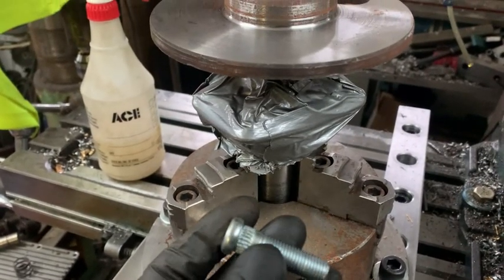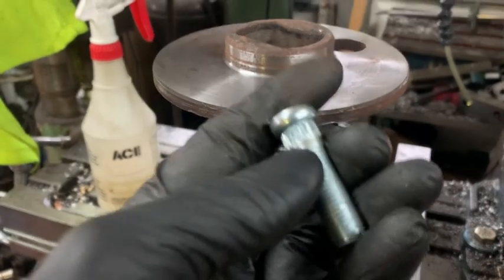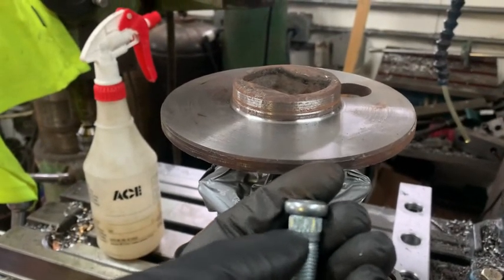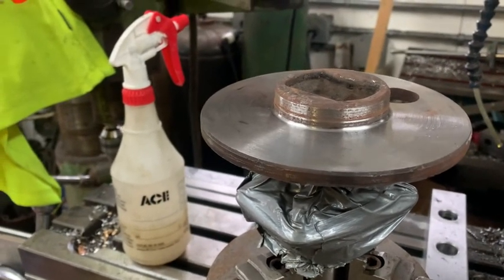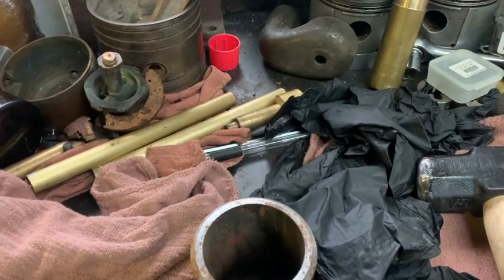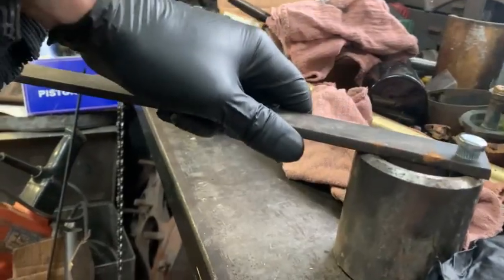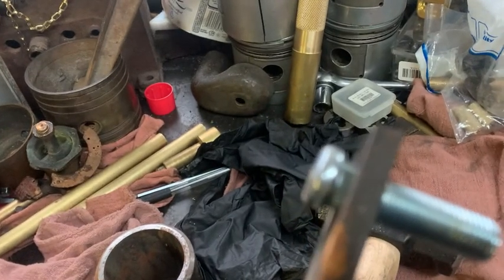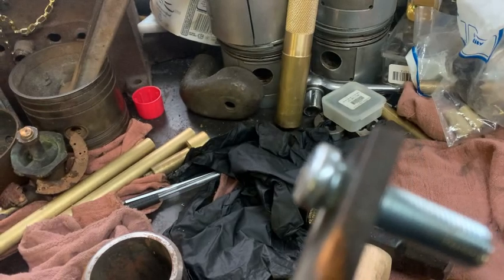He's not making a crap ton of horsepower, so we're just using a standard 7/16 stud. Just underneath the knurl is the shank diameter — it measures right about 0.450 to 0.451 inches. So I'm going to use a 29/64ths drill which measures approximately 0.453 inches. I just got a pilot hole drilled, and the stud fits — it'll go in and be held nice and tight. The knurls will cut into the metal; the minor diameter will slip through and the knurls cut a path.